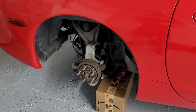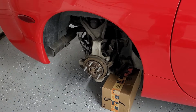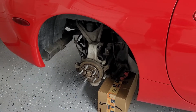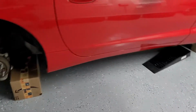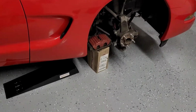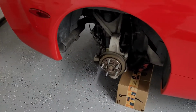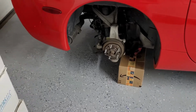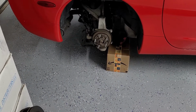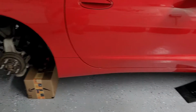What I tried to do was go a little bit more than a factory bolt by like, I don't know, probably 1/8 to 1/4 inch more thread. So I'm hoping that I can sit where I want in the front all the way down, and then a little more than what I would have gotten on the factory bolt. That's my theory anyway. So I measured it out. We'll see how it goes. 5 threads showing is what I ended up going with on both sides just to make it consistent. I'll see where it sits and I'll tweak it from there.